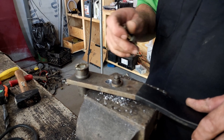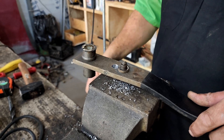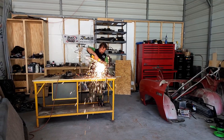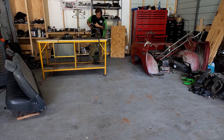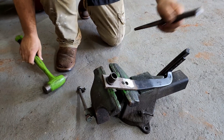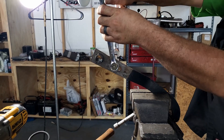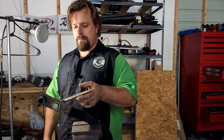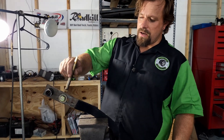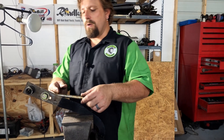We're not going to have enough room to get our bolt in there, so we're going to have to go ahead and remove the original pivot. As a bonus, we can use either hole. Our brake master cylinder pushrod is secure — it's not going anywhere. It doesn't have a lot of slop in it, but it's still free to move around, so it'll pivot no problem.